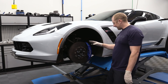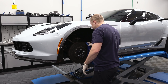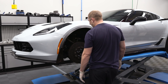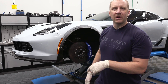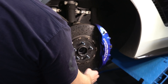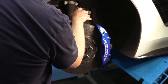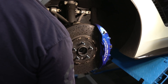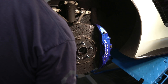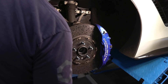I'm also going to steam this like I did to my M5 — steam it once I get all this off. I'll get some close-ups of what this looks like and why I think we should be replacing these. They look beat. We're going to weigh it and see if I'm ridiculous or not. So I'm going to take all four wheels off. We're going to take the caliper off, take the rotor off, then expose the drop spindle — the actual spindle. We're going to put drop spindles, which will lower the center of gravity by an inch — I guess it moves it up into the wheel well. We'll deal with the sway bars as well.